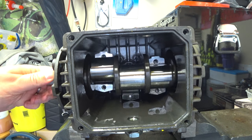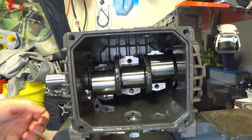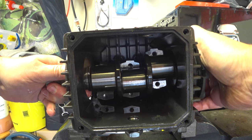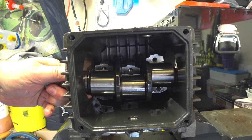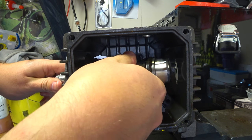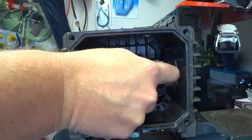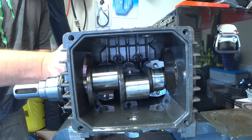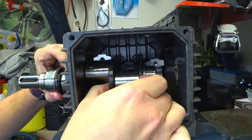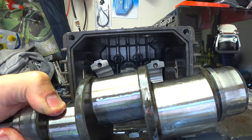So what you're going to want to try and do is push these back up to give you clearance around the crank like so. Then pop your caps back off - one, two. And then she should, with a little bit of movement... Because if she doesn't, then obviously I can't work out. Takes a little bit of jiggery pokery. But the crankshaft is out.